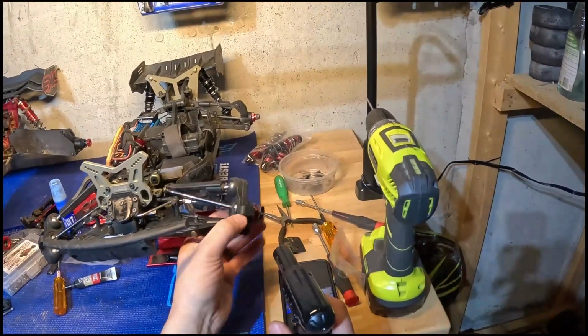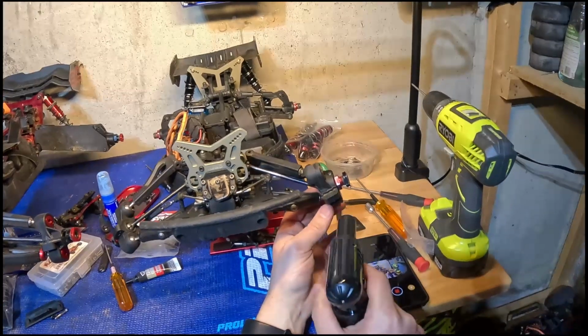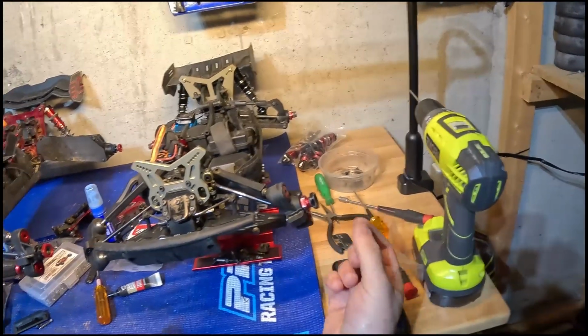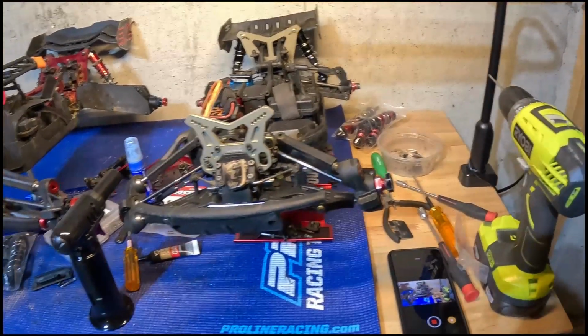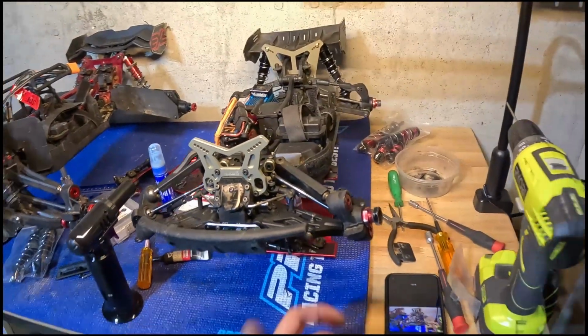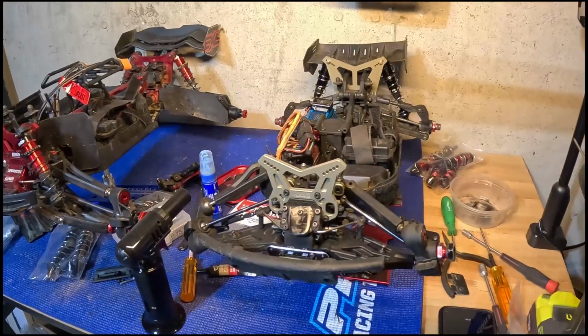The same here when you're taking off the hubs. You would take off this wheel nut, try not to hit the plastic, and just sort of torch it. Torch, let it bubble. You might see the thread locker bubbling. It will be good and hot. And of course, do not touch any of this. It goes without saying, but you can forget. So just grab it with pliers and it should come right out nice and easily.